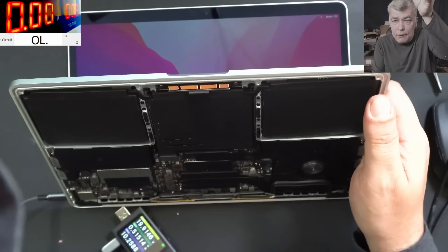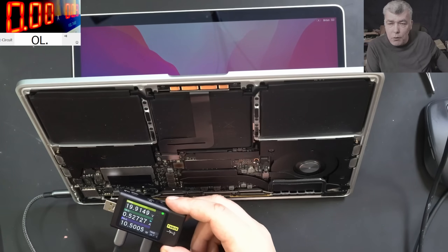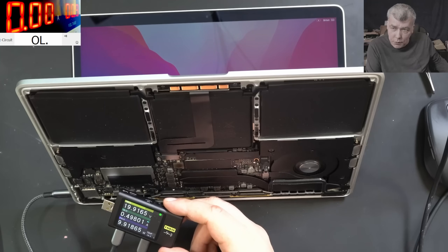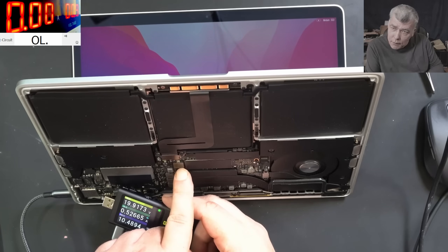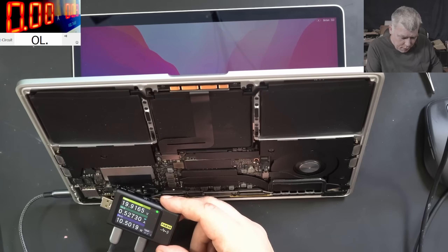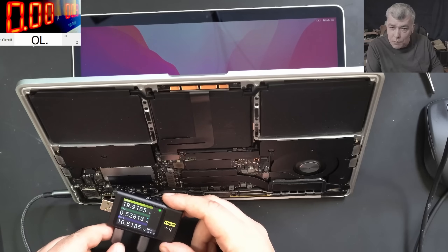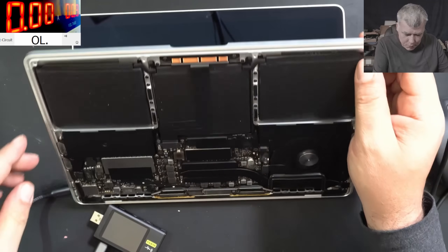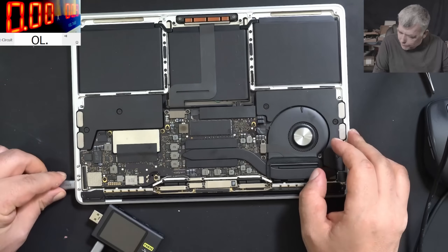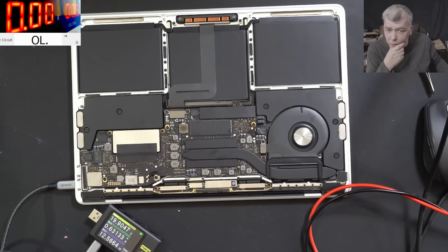We have a picture, but the battery has an X on it and it's not charging. So does the original fault have anything to do with the battery? I believe this is a second fault. We replaced the capacitor, but this coil was heated a lot — and it's not charging, so this has to be linked somehow. If I take out the charger, the laptop goes off. The battery is not speaking with the SMC chip.